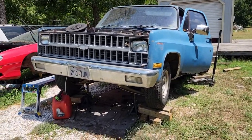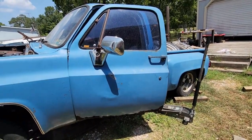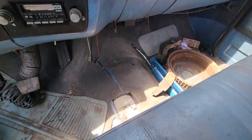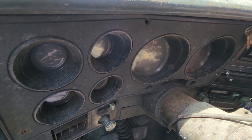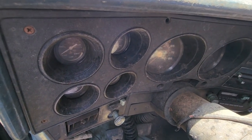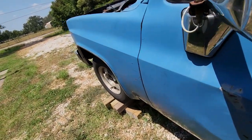Okay, there she is, pretty much the last way you remember seeing her. I put the gas can down under there. You'll see a bunch of bolts and whatnot under there but that's totally fine. Let's look inside real quick — I'll show you some neat things this truck now does. Number one, the shifter is out, which ended up being a royal pain. The newest thing: last time we left you it would start and run, but now key on — nothing at all, like the starter's not even there. The battery's got plenty of juice because I can turn the light on, so it's not the battery. I'm pretty sure it's the starter — that's probably the next thing we're going to look at.